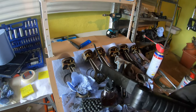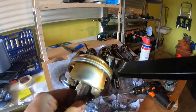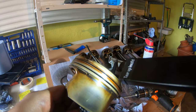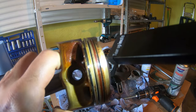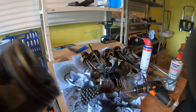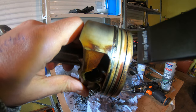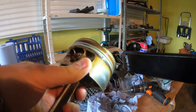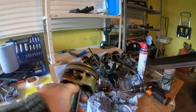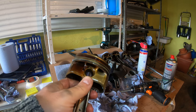What you need to do is clean up these pistons and piston rings because there is a bit of gunk in the piston ring grooves — just a little bit. Let me try and give you a better picture down in there. You can see the black kind of crud that's sitting there. We want to get rid of that.